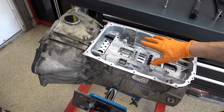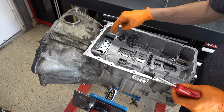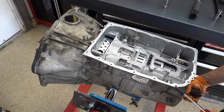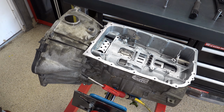Okay, that's a very nice seal, even with this kind of crappy plastic little nozzle tip here. And that's what you want to hear. You don't want to hear any kind of hissing coming out of that clutch. All right, everything should rotate nice and free when you turn either the input shaft or the output shaft.